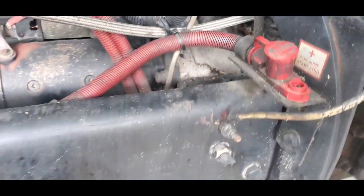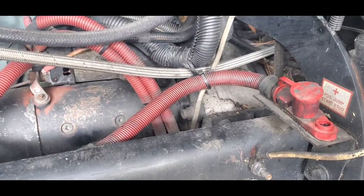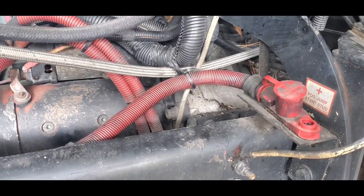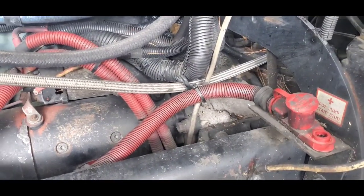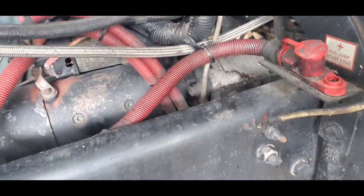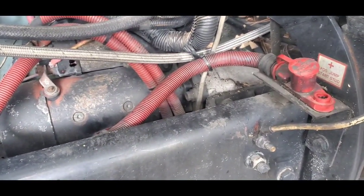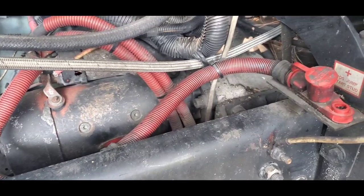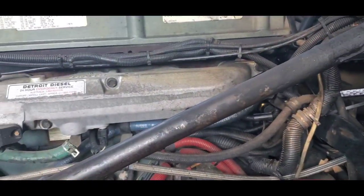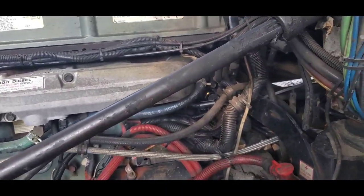Now we're going to be moving on to the oil pan, because my system is still pushing oil, but it's not building up. The gauge is still not working, and I have a brand new gauge as well as a brand new sensor. So what I'm going to be moving to next is the oil pan, checking out the oil suction manifold as well as the oil pump, and checking and replacing the O-rings to make sure that my engine and system is being properly lubricated. So stay tuned for the next videos on how to do that.